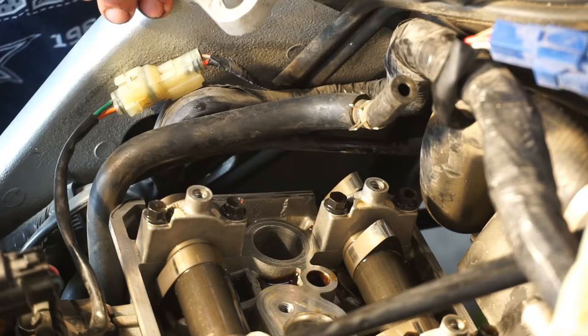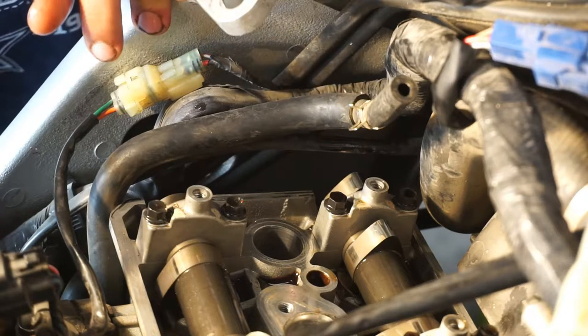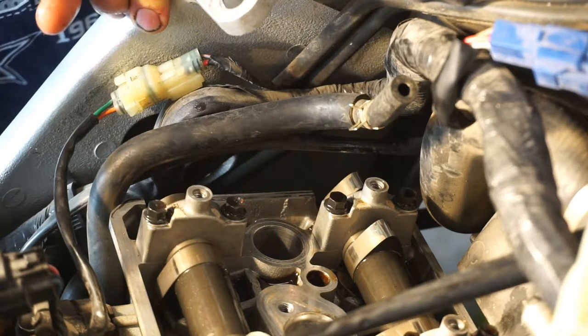So what we did is last night we got all the panels off the FJR, drained the coolant, took out the spark plugs after the engine was moderately cool at least, got the valve cover off, all that stuff, and then let the engine sit overnight so that we can check the valve clearance with the engine cold.